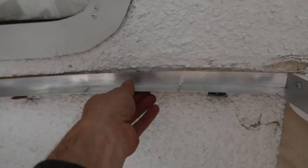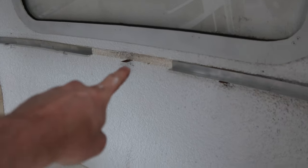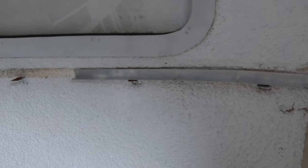Okay, before I move on to the next thing, I'm going to show you what I've got done. I wanted to continue with what I was doing, but unfortunately, when I went to Home Depot, I didn't get hardware for what I want to do. So I'll show you what that is. So there is the rail, it's starting to span the whole front. And you can see that I have cut these little angles here so that it matches the contour. And then I just have to put a piece in the center. And then I'm going to use these existing brackets here, but I'm also going to put holes through the body and then fasten them with big washers on either side. And that should make a pretty sturdy mounting surface. So yeah, that's what I did there.